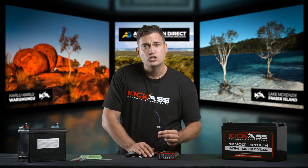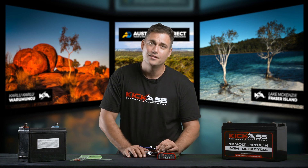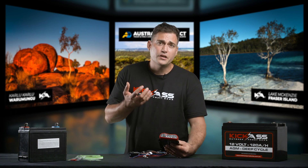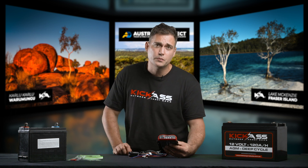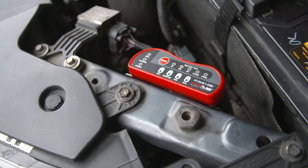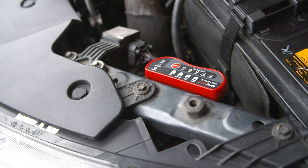And this is an ignition wire — the blue one — that needs to be used in vehicles with smart alternators. We'll talk about that a little bit later. The first decision you'll need to make when installing this charger is where are you going to fit it. The key is to put it as close to the auxiliary battery being charged as possible. A great thing about this charger is that it's water and dust resistant, so if that means it's under the bonnet of your vehicle, that's fine. Install it in a space and try to keep it away from heat and water as much as possible.